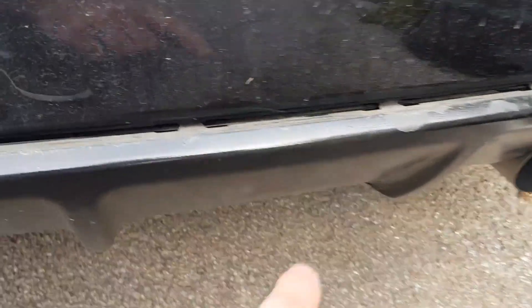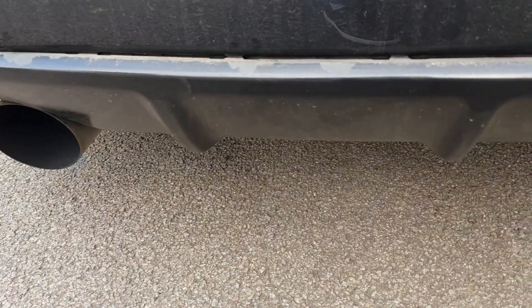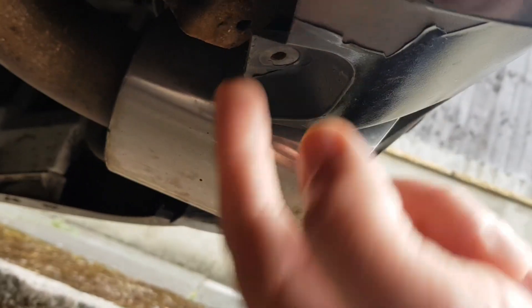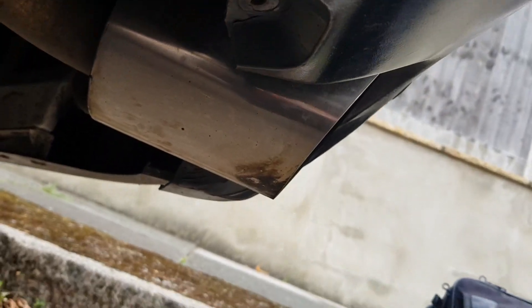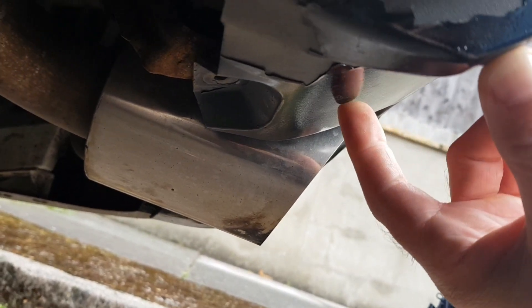Because it needs painting - I've already just pulled it out a little bit, but yeah it's all chipped along here, it needs a respray and we need to get ready for Ford Fair. Get underneath the car if you've not done this before. There are two screws - one on this hanger and one on the other side. Really simple, just undo those two. Those are the only things holding this on, as well as the clips at the back. Once that's loose, come around the front, pull on this side and it will clip out - pop out, there we go, and it pops out all the way along.